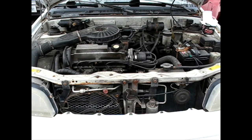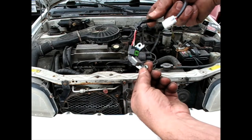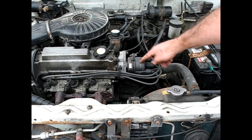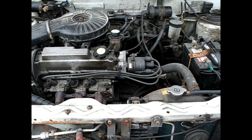For today's video, I have a 1992 Geo Metro LSI with the three-cylinder, one-liter G10 engine. I'm going to be replacing the spark module — or whatever your word is for the ignition pickup — that goes inside the distributor. And just for general reliability purposes, while I have it off, I'm also going to be replacing the cap, the rotor, the wires, and the spark plugs.